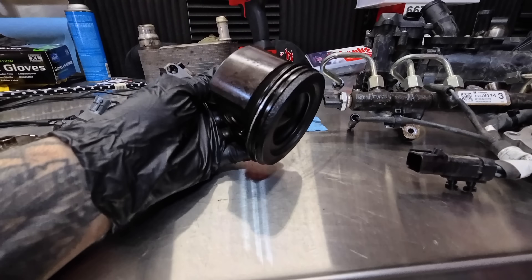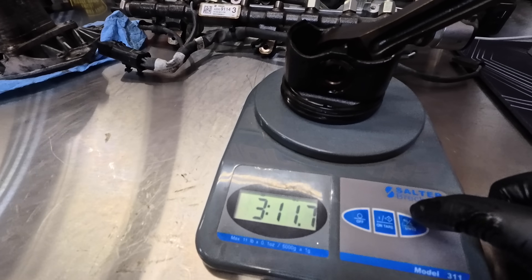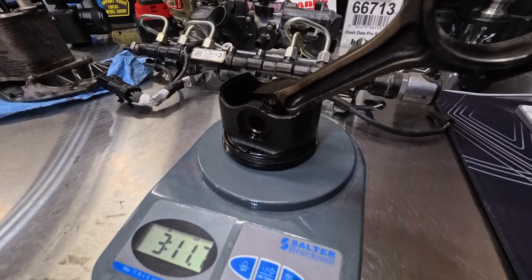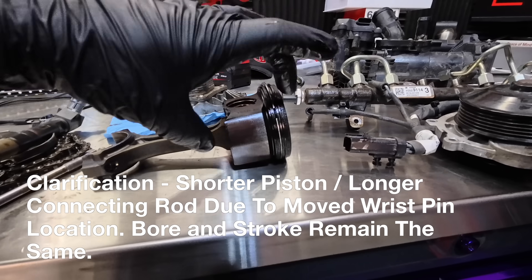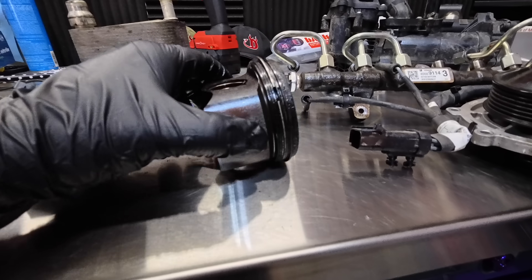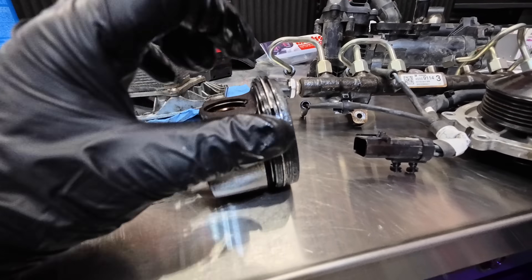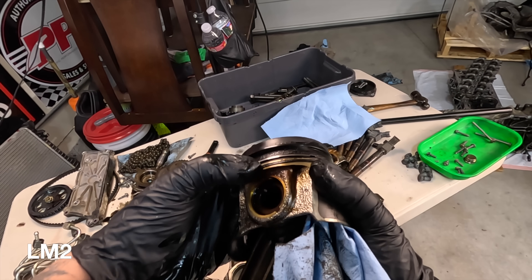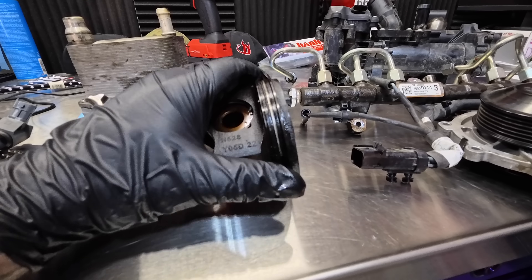Pistons — all new steel piston. This is heavier. The piston weighs 1,693 grams, which is three pounds and 11.7 ounces — a beefy piston. By going to steel over aluminum, they were actually able to squeeze down the piston because steel is stronger, making it much more robust. If you've seen my LM-2 teardown video, on that engine the second piston ring was seized solid with significant carbon buildup. With these new steel pistons, we're not seeing that at all — and that's a huge plus.